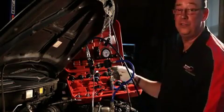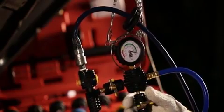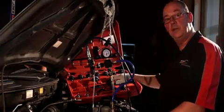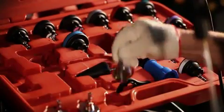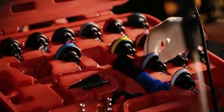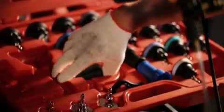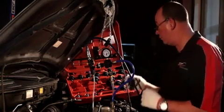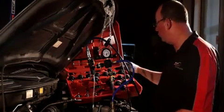What we've got here is a cooling system coolant evacuator and charger. We've brought two systems into our new program. This is our bigger unit, which comes with the coolant exchange unit. It has a range of bayonet type caps, the new generation screw-in type caps, external and internal. For those we can't fit with this kit, we have a universal adapter — this cone will seal onto the radiator. There will be a limited amount of cars we can't service with this range.